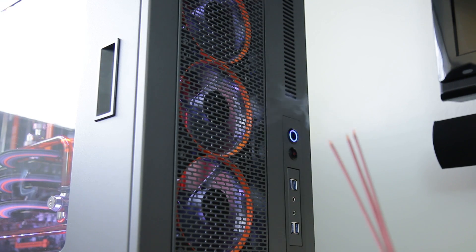That brings me to the next point: how I'm able to achieve positive airflow in a case like this where I have three intakes and five exhaust fans. I've got four exhaust fans on the upper 480 rad on the top of Skunk Works pushing air out the top — we want the air to go out the top because that is the natural airflow; as heat rises it's going to want to move up. And I've got one exhaust fan on the back. The key point: the number of fans has nothing to do with the pressure whatsoever. The number of fans either on intake or exhaust has nothing to do with whether the case airflow is balanced positive or negative. It has to do with volume and RPM.